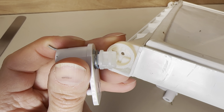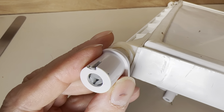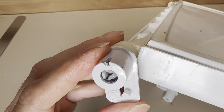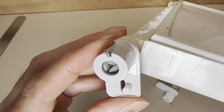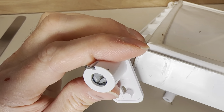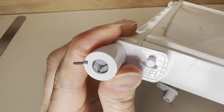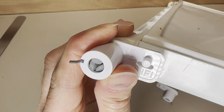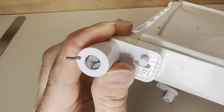When you first install the door — and I'm going to point this out several times — you need to install the door in such a way that the arm of the spring assembly is at about a 90 degree angle to the door. Then one of the final steps of the assembly will be to pivot the arm so that it's in line with the door, and that winds the spring which closes your door by itself.